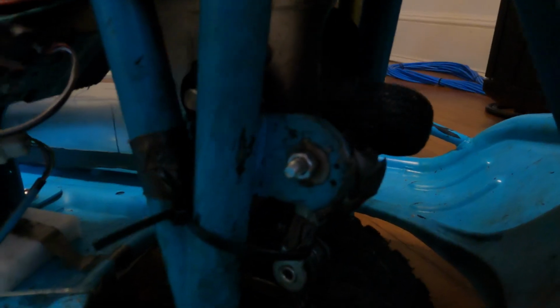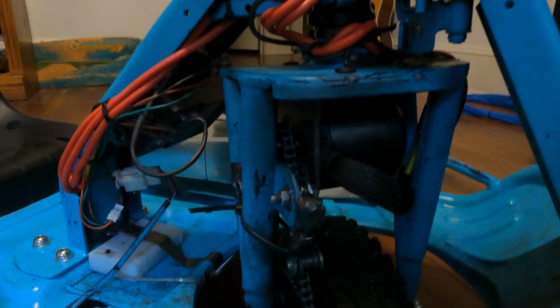But yeah, and then I also screwed up a little bit with the chain tensioner because it was so tight at first. I was trying to figure out how to do that, so I actually took the old one off, and then when the chain stretched, it became a little loose, and there was a whole bunch of problems. So the stock tensioner here has a metal bar that comes all the way down to here, and is what prevents the spring tension from going further back.